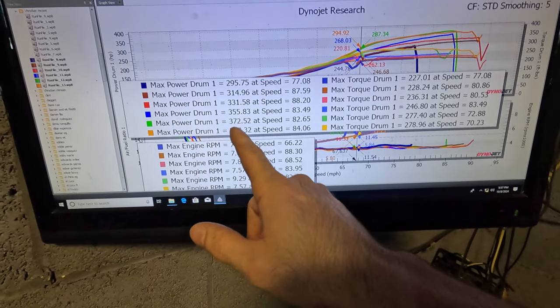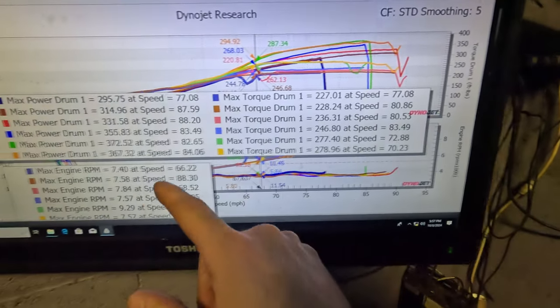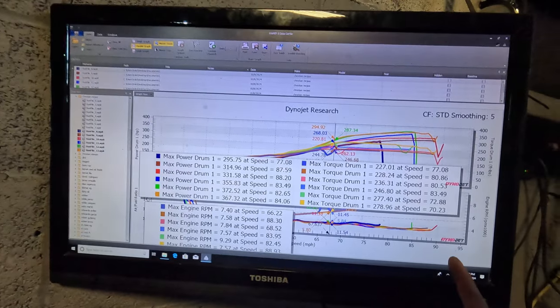We are on 24 pounds and made 372 horsepower. Then when I raised the boost cut from 25 to 26 psi, it broke up. I'm going to gap the plugs down to 0.018" and do a third-gear pull. This is fantastic power and fantastic torque — I'm super excited. Boost cut is set at 26 psi. I'm going to do a third-gear pull rather than fourth gear so I don't stress it too much. Let's see what this Hail Mary pull makes.